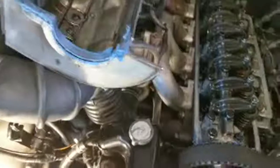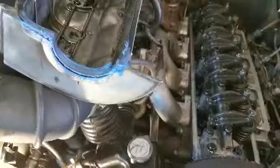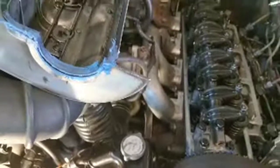So, okay. What is the next step in order for me to make more progress? Hopefully I don't have to take any of the cam gears out. The thing is, there's normally like a flat spot in the cam which can lock it up while it's in there, and it's apparently at that point there. And I don't know how I'm going to do it because it's just really tight, and this is not going to be easy.